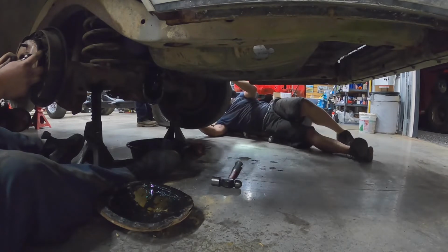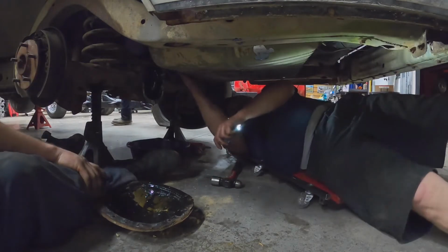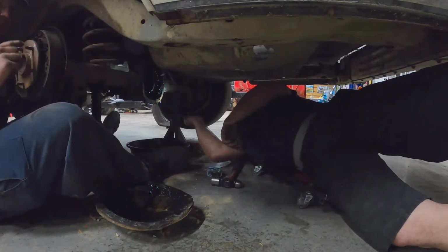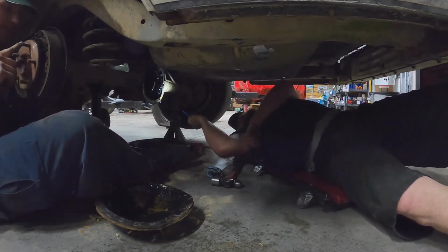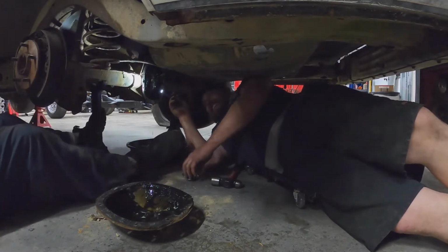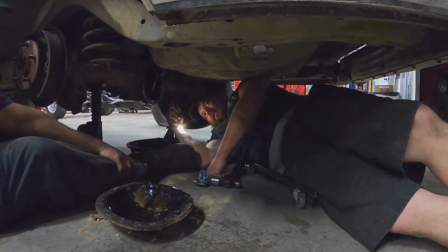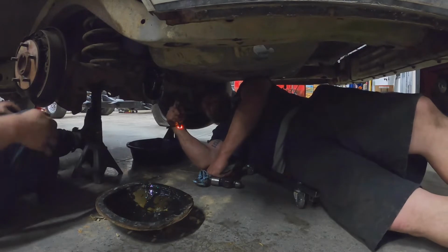Yeah, it's not even 1.5. This is stupid. Same thing with or without. Hey, turn the yoke. Set it centered and then just, there, I got it. Let's go with this one. Half. One. What the crap? Same. This is not a 1.5 rear end. It can't be. That means every time that turns one time, my tire turns one time. So basically you'd have 900 horsepower at the crank and 900 horsepower at the wheel, by that logic. It's a 1-to-1 gear ratio.